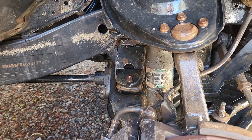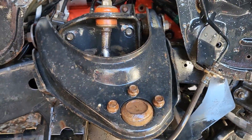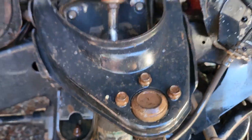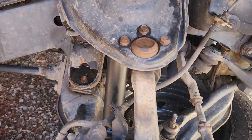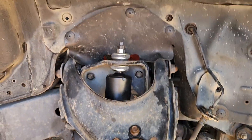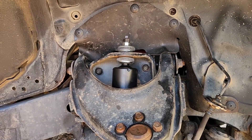So I'm going to take this shock out and put the new one in. Vice grips on that, take off that 17mm nut, another one down there - yep, exactly the same. There it is, job complete. I've also taken the back shroud off the other ute - this one went missing. It's been replaced. I'll chuck the wheel back on and take her for a drive to see how she goes.